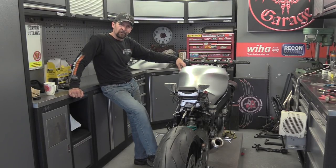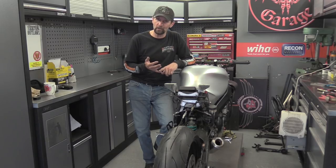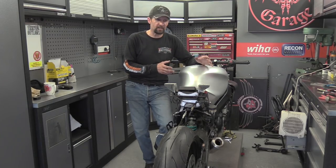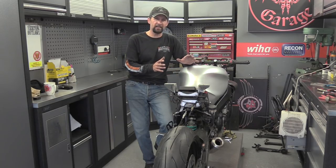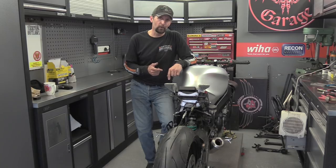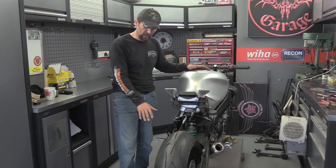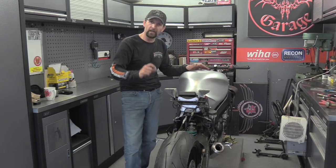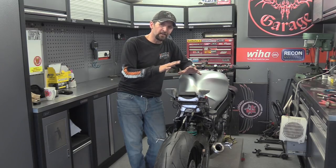Mission accomplished and absolutely chuffed - I could not be more pleased with that result. That could have been so much more work - I could have had carbs clogged up and fuel residue needing to be stripped, cleaned, and then rebalanced. They are absolutely smooth as silk, need absolutely no attention at all. The tank itself could have leaked, the fuel tap could have leaked - so many things could have been a pain after two and a half years without fuel and ten months not having run. I am going to change the oil because it sat for an awful long time, so there will be a little maintenance video. I've also got to sort some sort of chain guard out. As for the under tray - I may or may not use what I started the other day, I've got another idea using some basic fiberglass - I might buy a basic under tray and cut it up and adapt it because it is fiberglass and super lightweight. And that brings me to the final point of today's video: I'm going to weigh the tail panel.